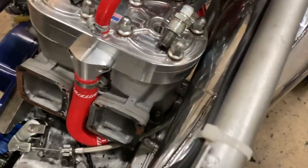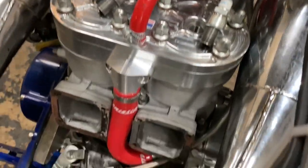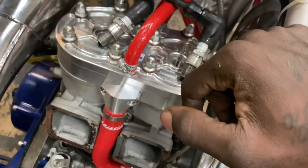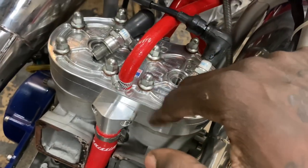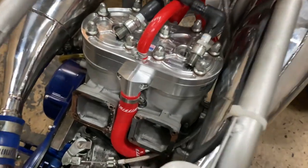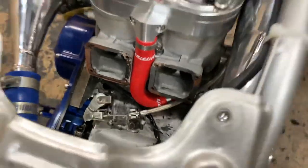The next thing I'm going to lean towards doing is a full inspection. I'm going to pull the top end off, because his reeds are good and the bike has good spark. So the next thing is the top end — I'm going to pull that off and see how the heads look inside and the pistons.